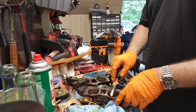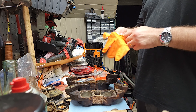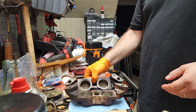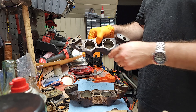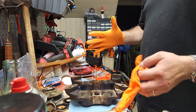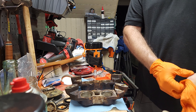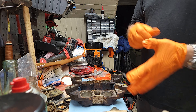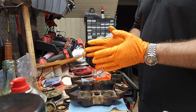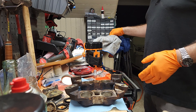I'm going to clean these up and we'll be back. We're back in the shop - it's been a little while with some family stuff going on. These piston chambers have been cleaned out for the most part. They're pretty smooth on the inside - I think these are perfectly salvageable and usable. Next is taking the kit out and starting to put the new pistons in, then the o-ring gaskets, then torquing the two halves back together. The torque spec is 130 foot pounds.